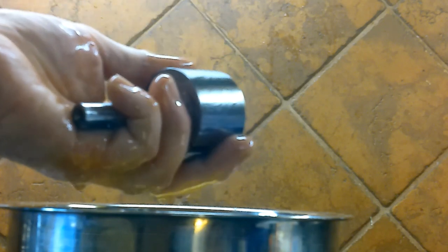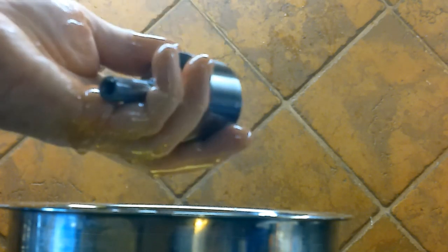Oil is so important to the life of a vacuum pump. Oil promotes lubrication, removes heat, and most of all, it covers the internal workings — these highly machined parts — in a film of oil and protects them from moisture and any acidic action. If you have an oilless vacuum pump, continue to use it but monitor it closely. You may have to tear it down from time to time to hand-lubricate some internal parts and inspect the bearings. If you have a chance to return to a regular vacuum pump, I would do so. The premium pump is a great pump — simplistic by nature and it provides everything you need to successfully freeze dry.